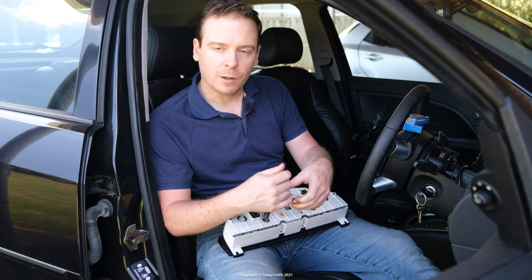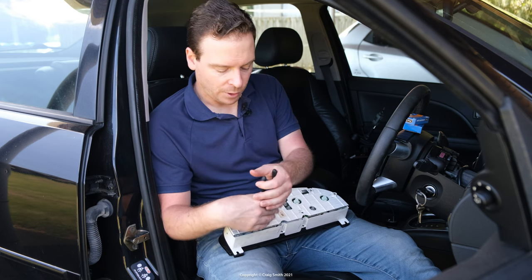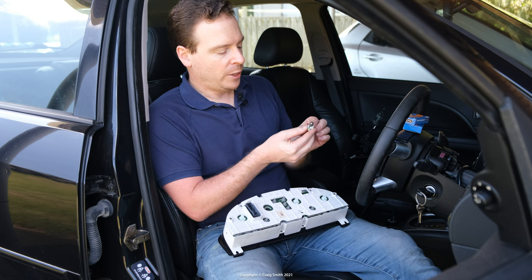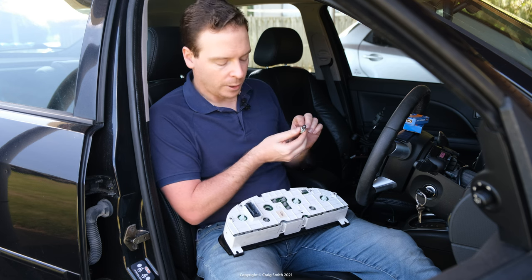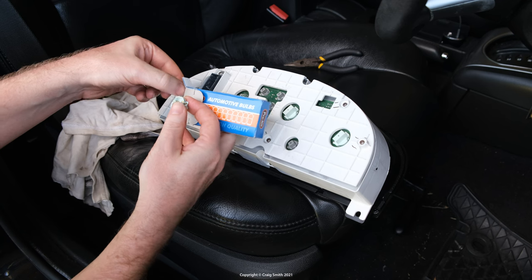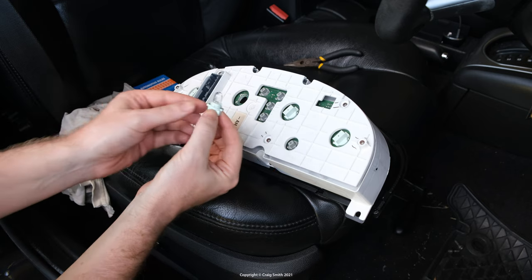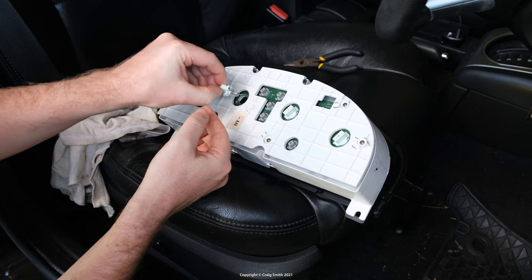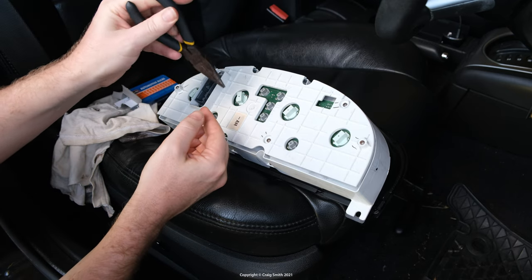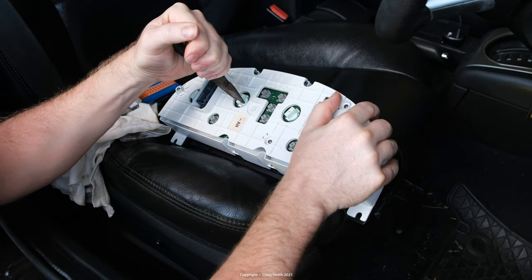That's a bit of an issue because many people end up replacing these with the more common but overly powerful versions when they do this job. If you put a five watt version in — especially with the larger ones — you're going to be adding quite a lot of extra power, which means heat. And it's heat that tends to ruin the little gel filters inside the cluster. On top of that, it's going to be about 50% brighter, and if you don't have the brightness adjustment on the dash — which this car doesn't — that's a problem if you're driving at night because your cluster will now be too bright.